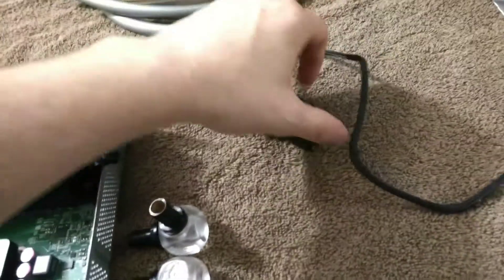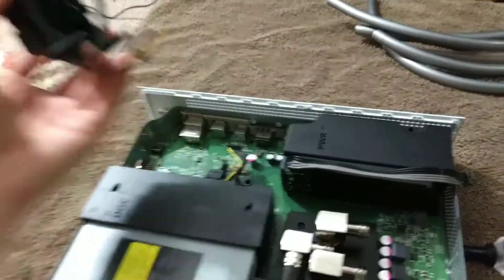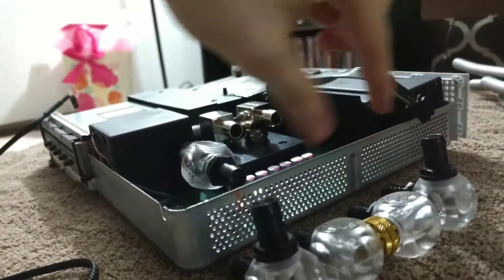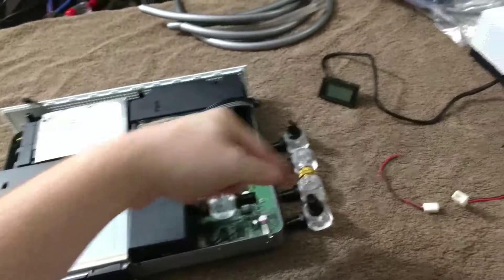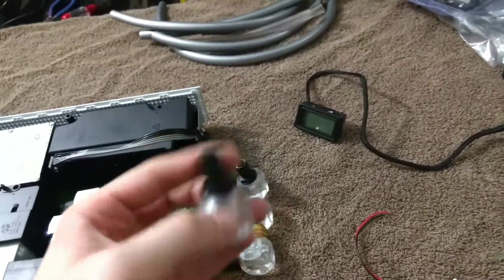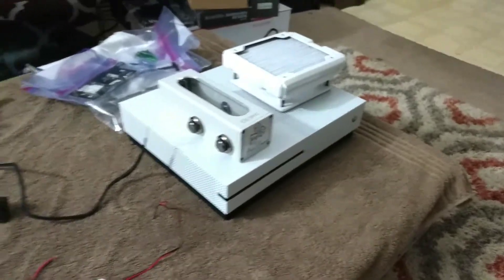For the temperature display, since it requires five volts, I'll tap it into one of the hard drive wires that has five volts. That's pretty much where I'm at now. I'll have to cut a little bit into the metal casing to make room for the tubing coming out. I'll have another video soon once I start cutting and figure out the loops and get all the wires plugged in. If you have any questions, go ahead and leave a comment. I also have to order some more fittings, tubing, and fluid, but thanks for watching.